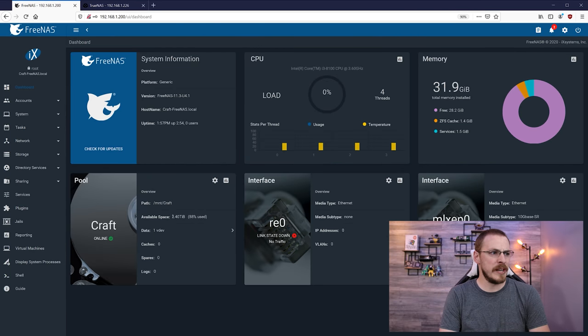If this was just me copying files onto it for storage needs, I could probably live with the extended wait time. However, I also edit my videos directly off of the NAS, so performance is paramount. In this FreeNAS install, I've been running six 6-terabyte drives in a RAID Z2 for two-disk parity. As you can see down here in my storage pool, I only have about 2.4 terabytes out of my 20 terabytes of actual space remaining. But it's finally time to give that data a brand new home on my TrueNAS build.